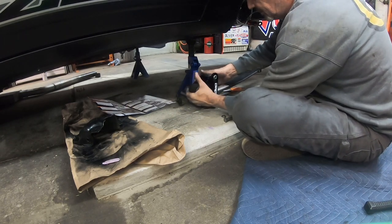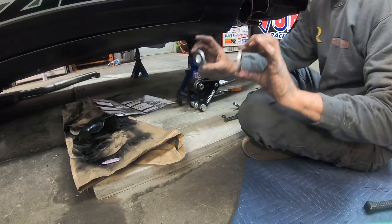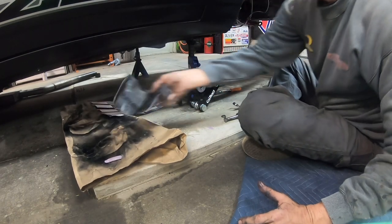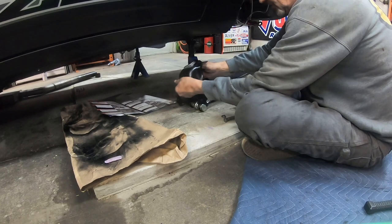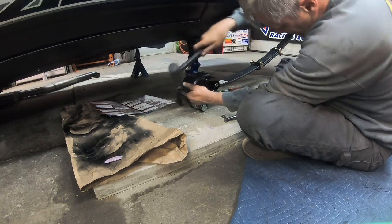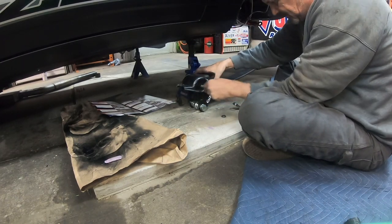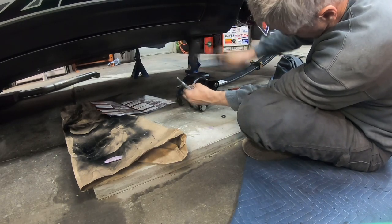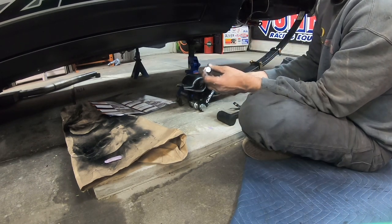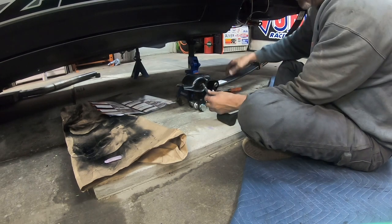The sticker is on the outside, and this slides in underneath — easy enough. A little tight from the powder coating but it slides in. For 70 to 81 Firebirds and some other cars they provide these washers — we do need them on my car, so put one on each side. I took a couple minutes and repainted this. Important tip: always put the bolt in towards the middle of the car, because if you try to put it in with the washer and nut on the outside it won't go up in.